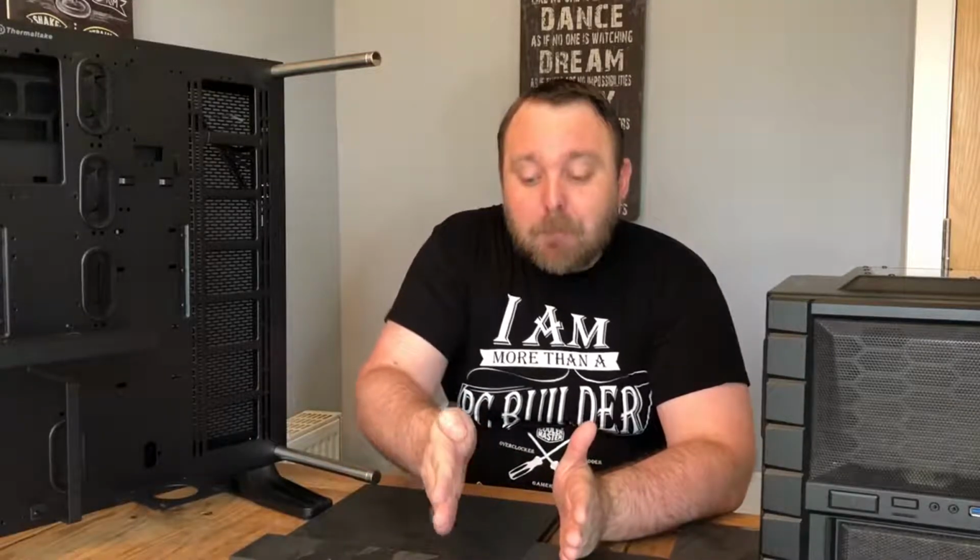Yes, you can still get a top of the line processor, but what you'll find on most of the smaller motherboards, there'll be a different series of chipset, and you're not going to be able to get the top of the line ones. Performance wise, it isn't going to be that drastic of a difference between them, but it's just something to keep in mind. That is why most builders, if they want to build a top of the line system, will still be choosing one of the larger motherboards. And in fact, if you get into the super high end, the enthusiast level, they've got an even bigger size motherboard, which is eATX, for extended ATX. But again, we'll talk about that more when we discuss motherboards in the near future.